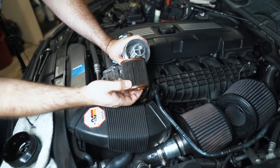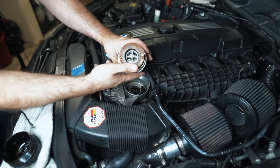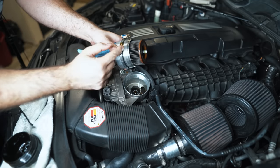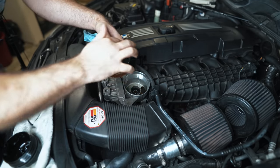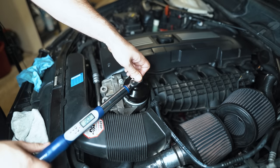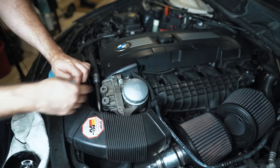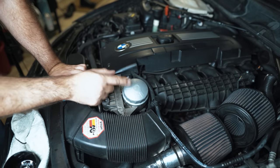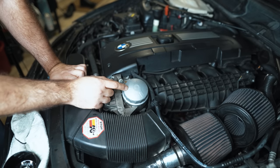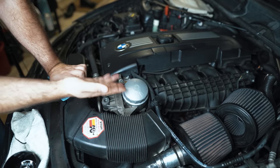My filter here has very few miles on it, maybe a few hundred, so I'm just going to put it back on. Insert it here and clip it down into place. Before anything, grab a little bit of oil and lubricate your O-ring. The final tightening torque is 25 newton meters. It's cool that there's an aluminum upgrade. I'll put a link in the description if you guys are interested in purchasing this — it comes in at around $30. And if you have a lot of miles on your original cap, some peace of mind: it's designed just like OEM, looks kind of OEM.